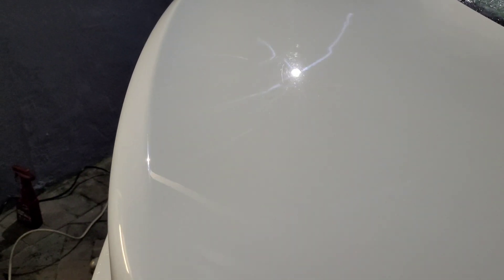This is where we're at on the boot lid. I did one pass with the Meguiar's polishing compound and the foam pad, and then off camera I did a deep crystal polish to get rid of more of the finer swirl marks. There are still a few scratches and swirls, but this isn't meant to be a detailing video. My goal was to get the paint on the boot lid as clean as possible to match the new spoiler, and I think I've achieved that.